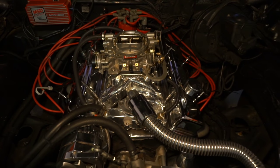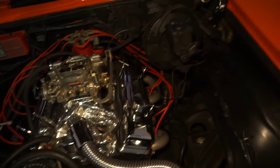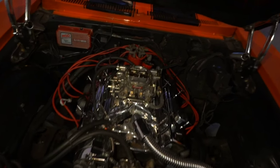Sorry again for the lighting — I gotta get some better lights in this garage. But if you've got a cam that's too big and it pulls too much vacuum, engines run off vacuum and if you don't have enough something's going to have to suffer, and normally it is your brakes. Brakes are now good — they'll be happy with the new motor and the new cam. That's probably one of the last couple times you'll see this engine in here. Supporting mod number one — pretty much the only supporting mod I'll need. If you've got a cam in your car and don't think the brakes are working too good, try a vacuum canister. Odds are that's probably what it is. Simple install, simple fix — thirty bucks plus a couple dollars for three-eighths line. All right guys, that's it for today's video, thank you very much for tuning in, and I'll see you next time.